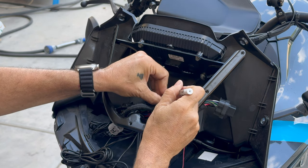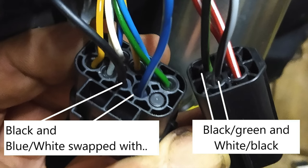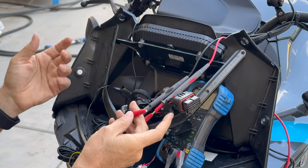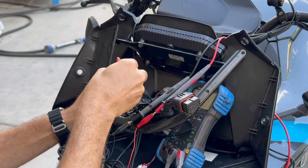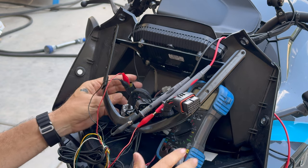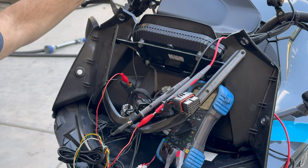Some of these are a real pain, so a little tiny screwdriver will really help. For this step you're either going to need an assistant to help press the switch while you hold the test leads, or — I'm lucky — I have a lot of little test lead extensions to plug in. In theory the black is one side and the blue with a white stripe is the other side. I've got those hooked up, my meter set on continuity which should beep, and I get a beep when I press the button — so we've verified this is the correct button.